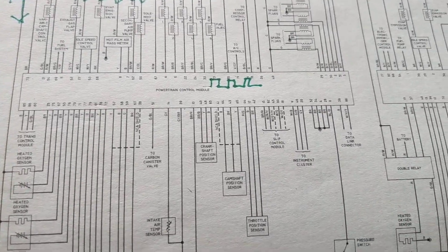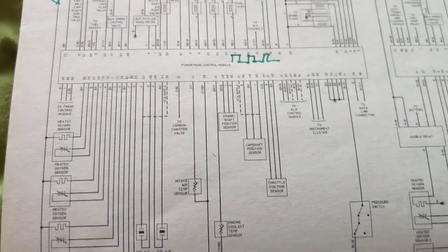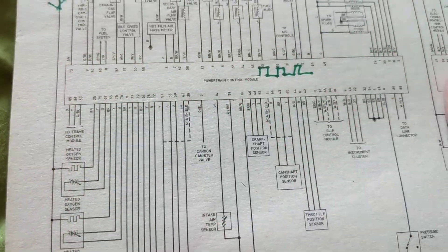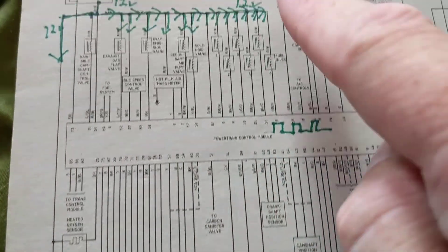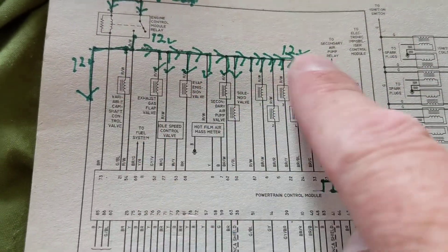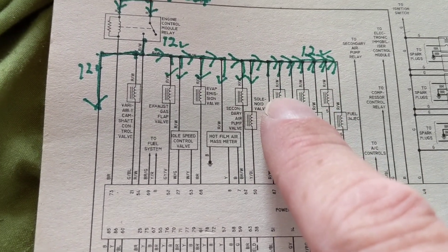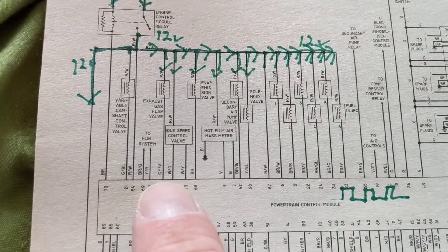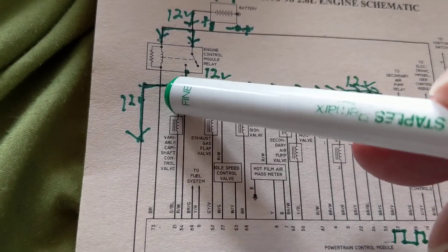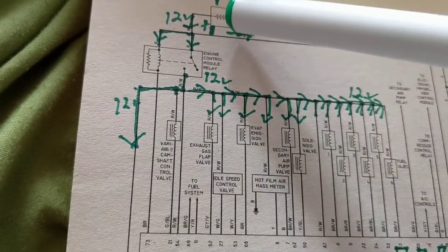I pick up on things like that, and I'm sure you did too. Please go to my channel for many transistor circuits. This is for a BMW, an older version, but look how straightforward it is — you really understand what's going on. It's easier compared to the other schematics. All the connections are easy to the eye. If you come to a sensor and don't have 12 volts, go to the relay and see if you get 12 volts. If not, trace back further to see where the 12 volts is lost.